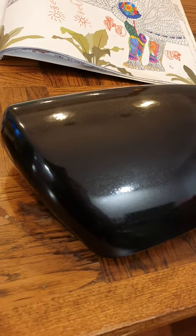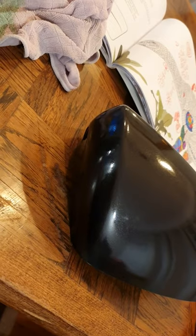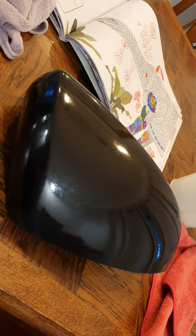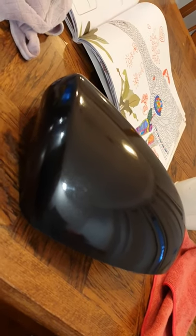Also at the time I was trying to fit it. One thing to bring up: when spray painting remember to get the lacquer into all the corners. There's an area where I didn't put enough lacquer and I can just touch the base coat in one spot — that's not ideal. It's not going to be too big an issue but it's definitely a learning point. One of the best things about doing little projects like this is you learn from your mistakes. This is the first wing mirror I've spray painted but I'm learning all the time.